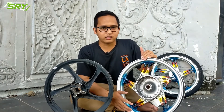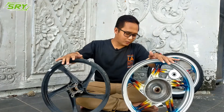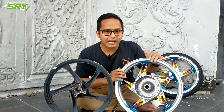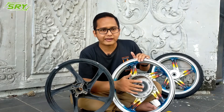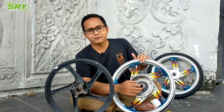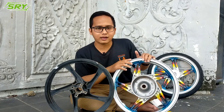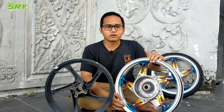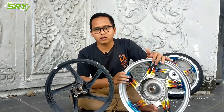Next, how do we tell which velg is good quality? First, I recommend looking at the axle hole — specifically the axle teeth (splines). This is the most important thing when buying a velg: check the axle teeth area and see if the teeth are thick. This is especially important for the rear wheel — the front doesn't matter as much. If the teeth are thick, that's great; if thin, don't buy it, because it may not turn properly when used. I was once tricked — the paint was smooth, no bends, but the teeth were thin, which makes it unusable.